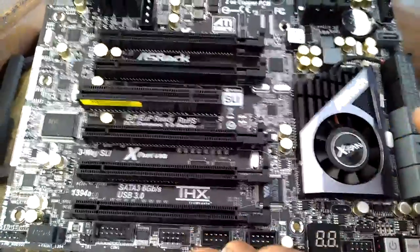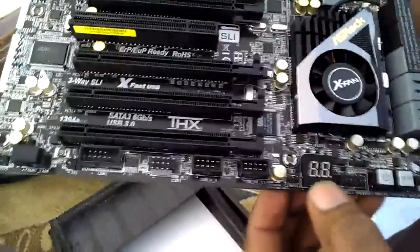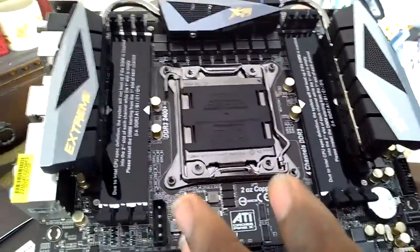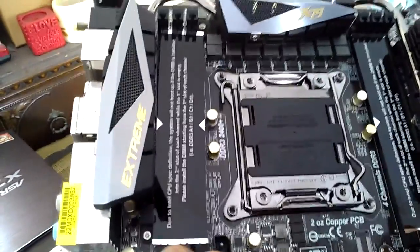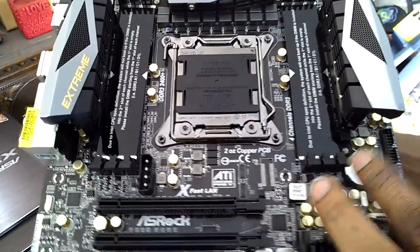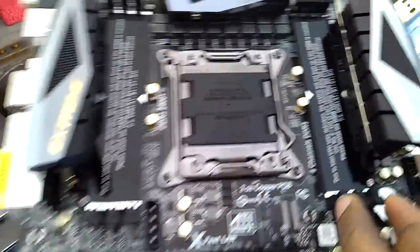You get five PCI Express 3.0 slots and one legacy PCI slot. There's a POST LED readout on the board. For fan connectors you have four total. You get six DIMM slots - the reason they include six is so people coming from the X58 platform don't have to buy additional RAM; they can run all six in triple-channel mode. However, if you want quad-channel, you need to populate the end slots only - one here, one here, one here, and one here - not the center slots. Any RAM in a center slot puts you in triple-channel mode instead of quad.